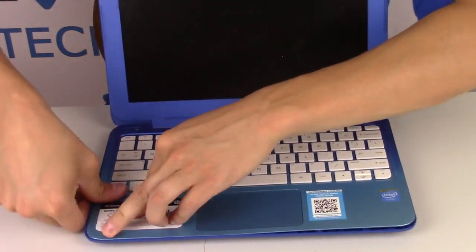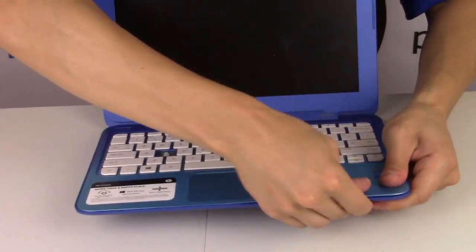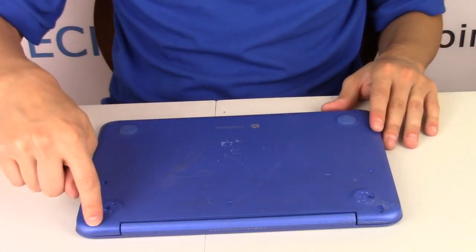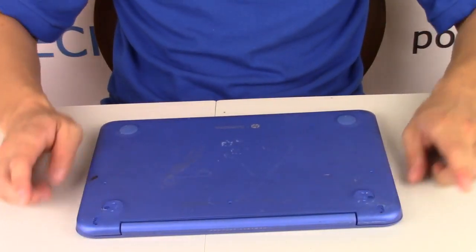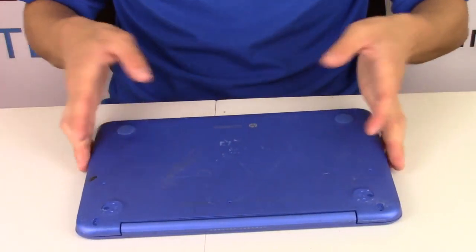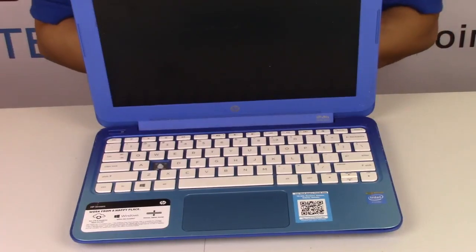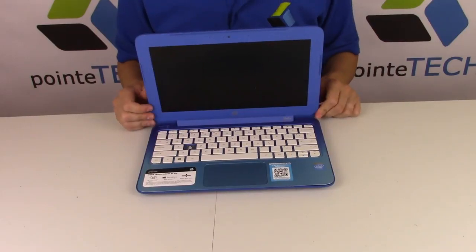You should hear a lot of snapping and popping going on putting this back in — snap snap snap snap, that's all snapped back in. Then you would replace your screws, put those two little rubber stoppers back, put the screws in, and put the round rubbers back and your screws in here. And that is how you would replace the motherboard on an HP Stream 11. If this was helpful, please like the video. If you like do-it-yourself laptop repair, please feel free to subscribe. Thank you for watching.